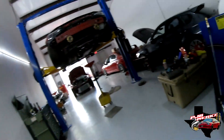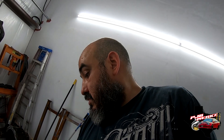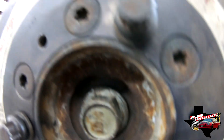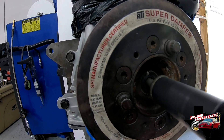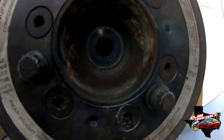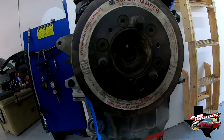So you use your crank bolt, put it on, tighten it up, and pretty much the pin is gonna sit behind it. This is all the way tight and you can't see the pin anywhere. That's gonna hold the pin in place so you don't have any problems with it coming loose. The pin is pretty much flush, and you can see how thick the harmonic balancer is — even if you go a little bit past the flush mark you're still gonna be fine.